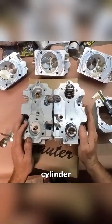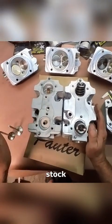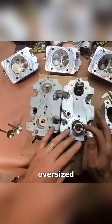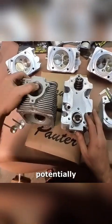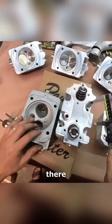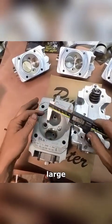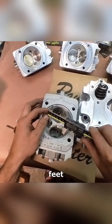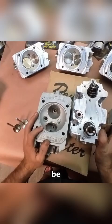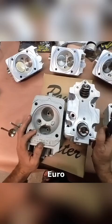The cost of the cylinder heads seems outrageous at first, but if you take a stock cylinder head and change the valves — put brand new valves in it — if you want to go oversize, you'll potentially have to change the seats too. We've got 52 millimeters there, and a 52 and a half millimeter valve there, so the seats aren't even large enough. Same thing on the exhaust side: seats are 44, and we could potentially get a 44 and a half. It'd be very close to getting these valve sizes into a stock cylinder head like Euro RS stuff.